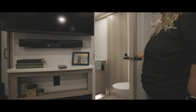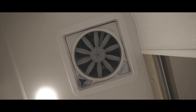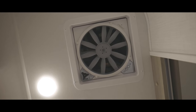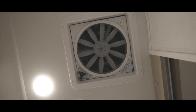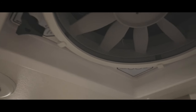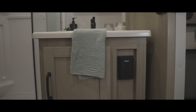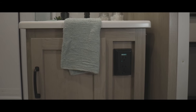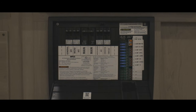Moving through this door, we find ourselves in the bathroom. In the ceiling, we have a vent fan to help keep your bathroom smelling fresh. The crank knob for the fan does lock into place, so to unlock it, you will need to pull the black handle down first before opening or closing the lid. Once you have the lid where you want it, you can lock it into place by pushing this handle up. The speed and off buttons for the fan are located in the corner next to the lid knob. In the vanity cabinet base, we have the RV's GFCI outlet. If the outlets in your RV stop working, this would be the first place to check to see if the outlet needs to be reset. If that doesn't fix the problem, check your converter under the fridge to see if a breaker has blown.